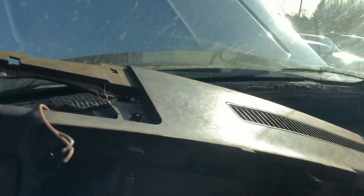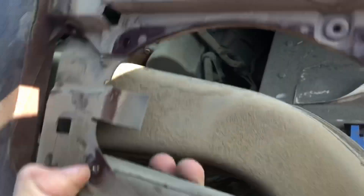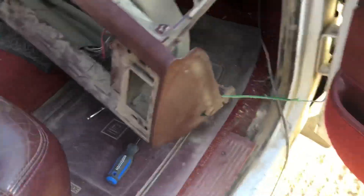For simplicity in removing the dash, you're going to want to undo this thing — it's just a bunch of seven mils all the way around, you'll see them. Don't do the ones that are right around the red trim or whatever color yours is, that just makes it harder on yourself. So I got a little carried away, but basically I showed every bolt you have to take out. After this, you have to pop this — these go over those little bolts and you pop it up and the dash starts to come. I started working on the other side already, undoing connections and such. You undo the harnesses. You also have to drop the steering column, which is just two fifteen-mil nuts. You can see it right there — two fifteens. And undo the door dinger, that's not hard. Basically you undo all the connections and all the wiring.